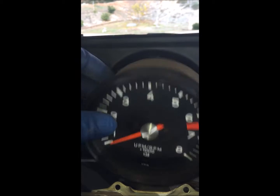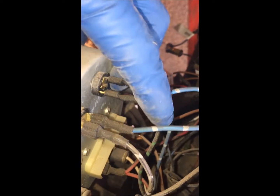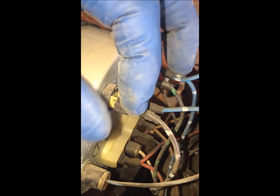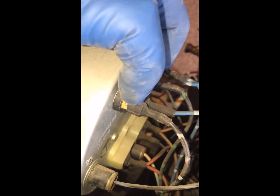The RPM gauge — behind there are the wires. This blue wire is going to this light, which is actually the left turn signal. We have this green with the black, which is the right turn signal, and then this blue which actually loops back around to the right turn signal. And the black with the white stripe for the right turn signal. After that we have the light bulb that illuminates the gauge, and then down below on the right side that actually probably runs the gauge itself.